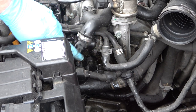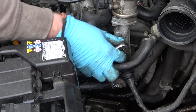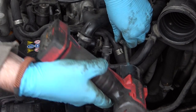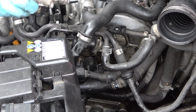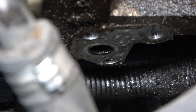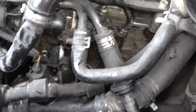The three lower bolts are out from underneath here. Just need to remove this last one here. And that is the actual secondary air intake manifold off — don't need that anymore. That's where our blanking plug, or blanking plate, needs to go. It can be very hard to film because there are other brackets in the way, but I'll get it on and then show you what it looks like.